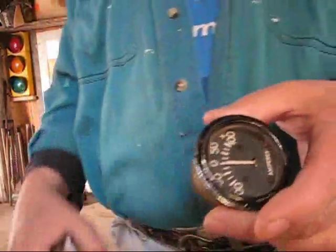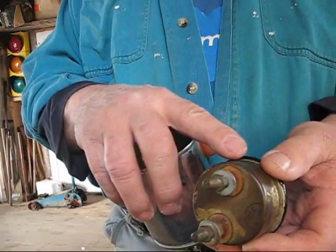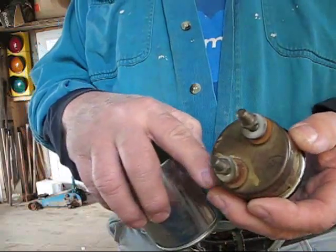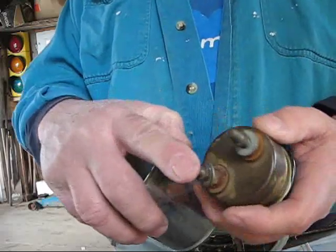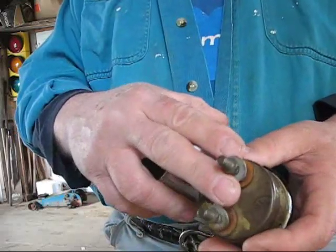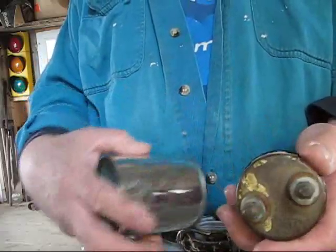Alright, I'm going to be putting this amp gauge in the car today. I don't have a holder for the back of it. What you usually have is like a piece of metal that comes up and across the back and down here with bolts holding on. But on this one, because these hook to hot wires, this has to be insulated from the piece of metal, otherwise you'll ground it to the dash and short something out.